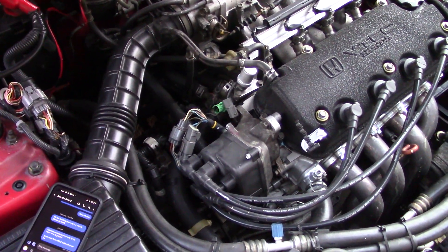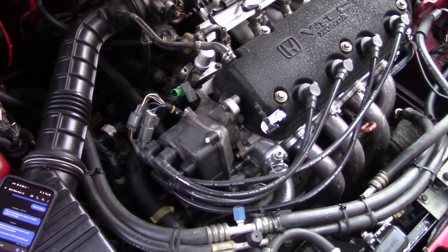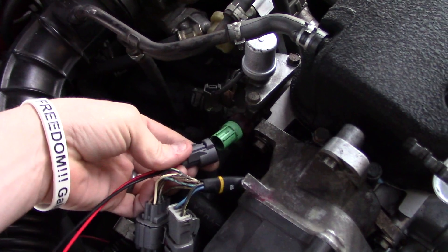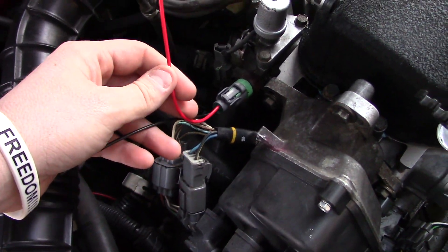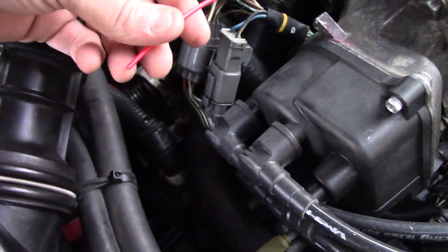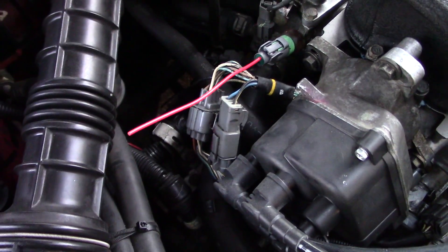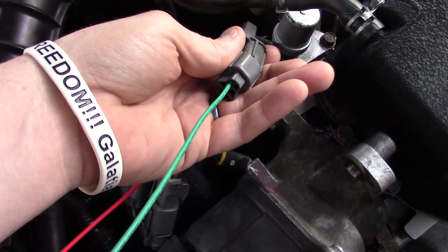Here are the wiring basics. I'm going to refer to a couple of different pins on the ECU harness — I'll pop up a harness wiring diagram in this video. The basics are: we have the solenoid and oil pressure switch. I have links to these clips — you can get them from the junkyard or I got them new off Amazon; see the link in the description. We've got a black wire and a red wire. The black wire goes to ground, which reaches perfectly to the thermostat housing ground right here — there's a bolt for the thermostat that is a pre-established factory ground. The red wire is going to go to pin D6 on your ECU wiring harness.